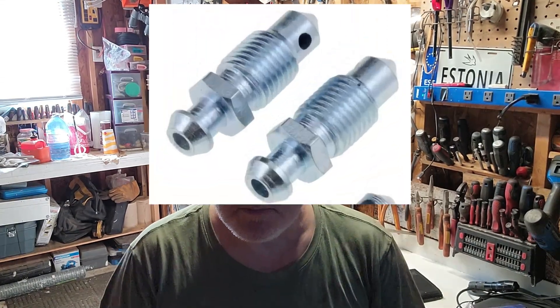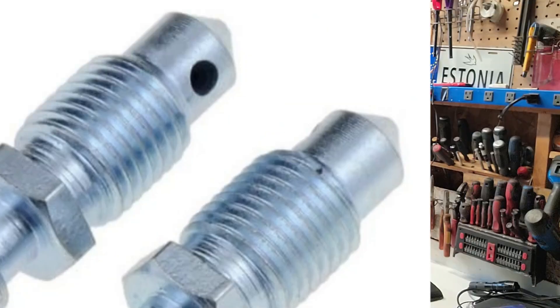What I use — I usually just use the bottle with a vent in it like I said, because when I bought that kit it doesn't come with a fitting quite tight enough. The bleeder kit is better for one person because if it's airtight and you've got the proper fittings, you just pump it up and then you can go in, or you can loosen it off and it will suck — you don't need anybody to push in on the pedal. So if you can get your bleeder screws out, no problem, it's easy peasy.